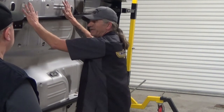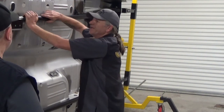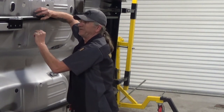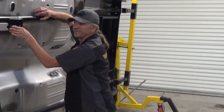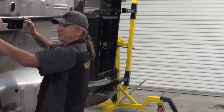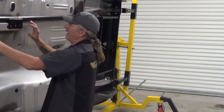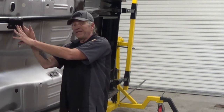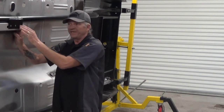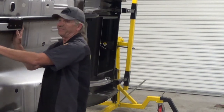The reason we're relying on Mike Meyer's racing subframe connectors is we don't have to cut the car up, for one. And two, it gives us, like I said earlier, the multiple points of connection, which spreads the torque out farther down the subframes. And we don't have to rely on an end plate weld, where this plate here actually saddles the end and runs down the subframe, and it has another plate out in front of it.